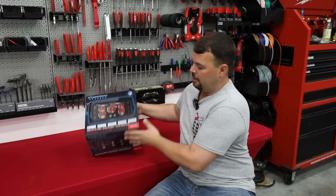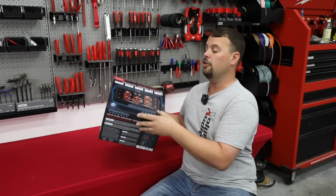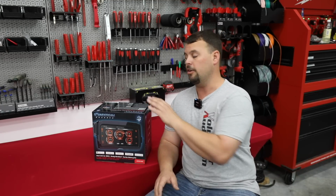Make sure you pull the serial number from the radio inside the settings menu. You can just go to the settings of the radio from the home screen. You can scroll down to the about part where you would do a software update, and right there it's going to give you your serial number. It's also available on the box. So there's a UPC code on your box. Right here is the serial number on the end of it. You'll need that. I don't want you to have to pull your radio out to get the serial number off the bottom of it. So while it's powered up, you can pull it out of the radio or you can pull it from the box. You'll need that before you can flash your MRR. Also, version 1.5 software. That's the latest software at the time I'm making this video. It does work for 21 and up.